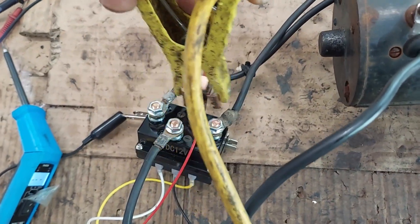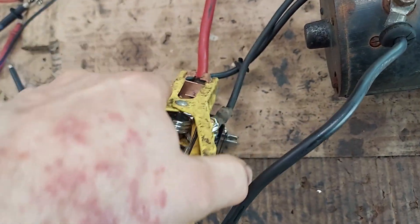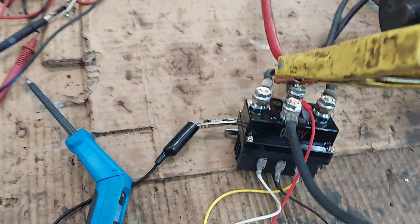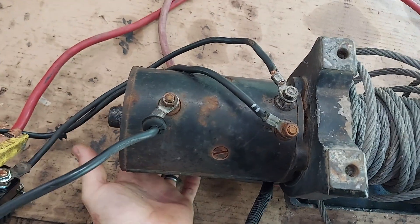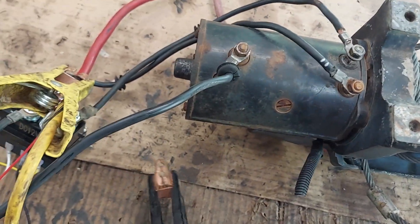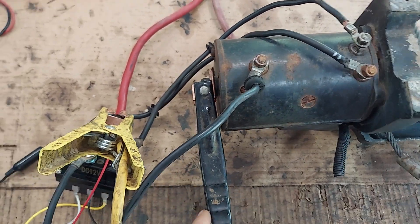Now that we've got these hooked up, we've got some jumper cables hooked to a car battery. We're going to take this power wire — be careful not to hit the other wires. Okay, so we got our power hooked up to the power cable. We've actually got a ground on the winch case. Some winches will have a stud on the bottom; this is just a case ground on this old Ramsey, so we're going to ground it right here.